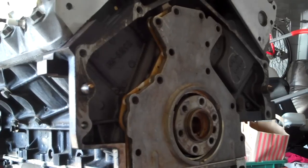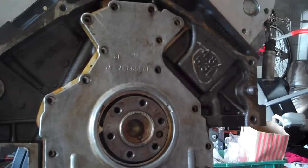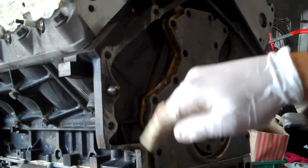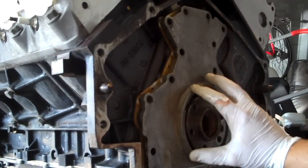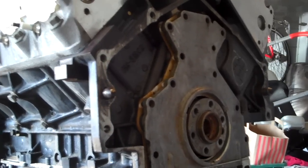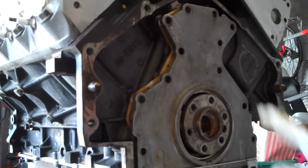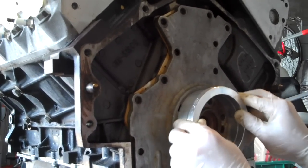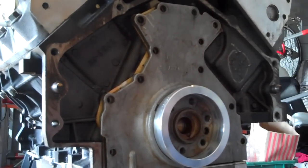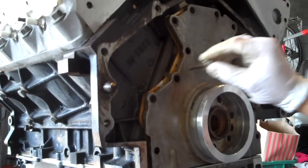It doesn't seem to me to be quite centered, so what I'm going to do is go ahead and loosen up the oil pan bolts, just kind of let the oil pan hang down and get out of the way of this cover, because you want this cover to be centered properly in all directions — and that is the purpose of this tool. Now that I've given this a little wiggle room on the oil pan side, all you do to center this thing is just kind of place the tool into position very gently, wiggle it in. Once it's in, this thing is centered in all directions and you can start reinstalling your bolts for your seal, making sure to follow proper torque sequencing and also the proper torque rating.